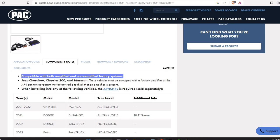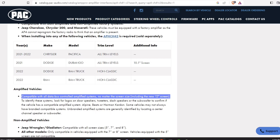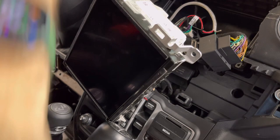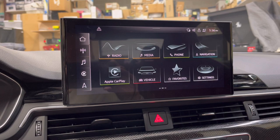In most vehicles a preamp adapter will only work if the car is already equipped with the stock premium stereo, where the signal from the radio to the stock amp is digital. However, there are some preamp adapters and some cars where the factory head unit can actually be reprogrammed to accept the preamp adapter — examples include the 2018-and-up Jeep Wrangler or 2013-and-up RAM with the 8.4-inch UConnect screen using the PAC adapter, and select Audi models with the NAV TV Zen V.